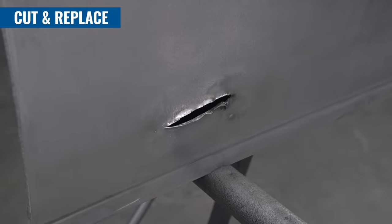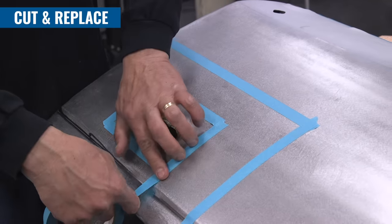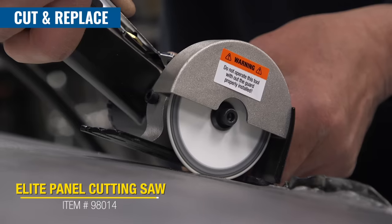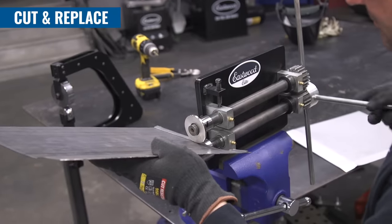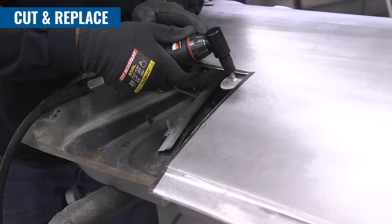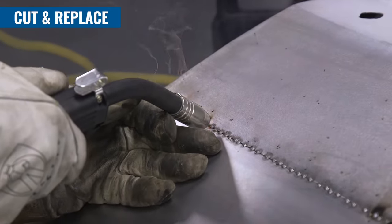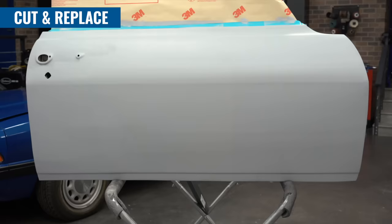Check out Mark's repair for this hole in a door he fixed recently. This isn't a hole from rust per se, but the repair is the exact same. He masked the area he wanted to replace, then used a panel saw to get perfectly straight cuts when cutting out the damaged panel and the new panel. The panel saw is also great for plunge cuts if you're working in the center of a panel. He used an eight-inch bead roller to match the style line on the door and got a gentle contour in the panel with a mini English wheel. After that, he prepped the area with a deburring tool — really nice because you can deburr from the top and bottom of the edge. He then stitch welded the patch panel into place to keep it from heating up too much and warping, did some finished work to roll the edges over the bottom, and after a quick coat of roll-on primer, the door was looking as good as new.